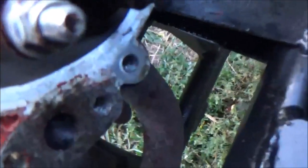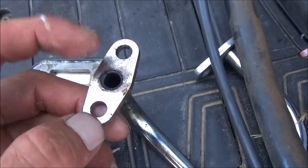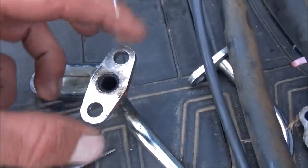So that's one little project you could do — you can delete the EGR system if you're going to make a blocking plate for right there. The GT vert showed a good way to make one: you just cut this off, put a little bit of weld in here, and then you can use this piece as your blocking plate.